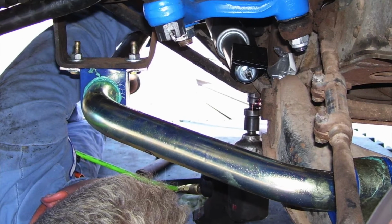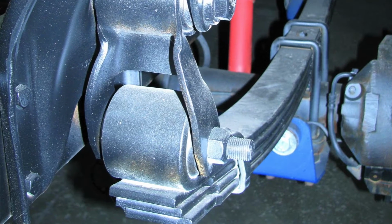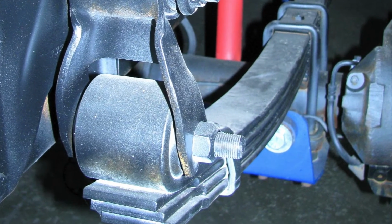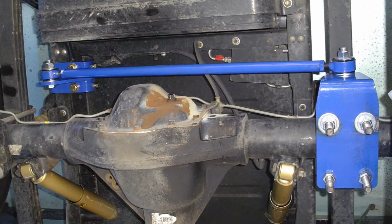The P32 chassis is also where we learned the key role rear axle play has in the steering of the coach. Your Uncle John and I were working on a customer's P32. After he did a bunch of upfront work, he still said the steering wasn't right. We took a look and noticed that the rear spring eye bolt on the shackle moved far enough to contact a rear compartment over a quarter of an inch away. We figured this probably wasn't right, so we built a prototype rear track bar to let the rear axle freely move up and down, but not side to side.